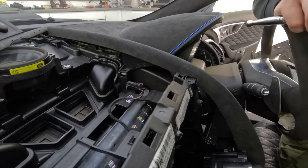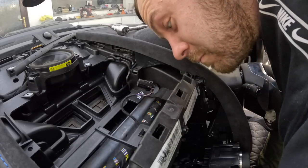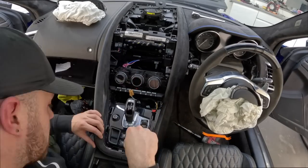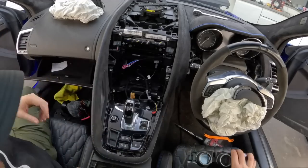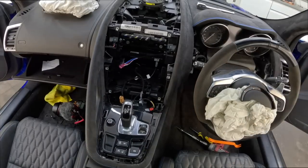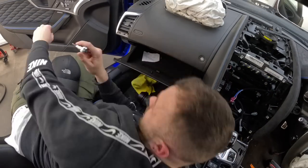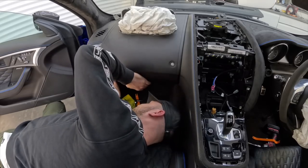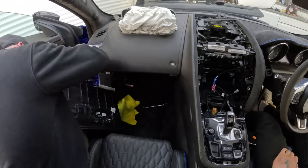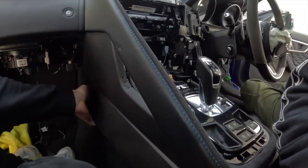The next thing I wanted to remove was these kind of side handles that go around the centre console. They were quite tricky to get off — not as easy as you'd think. To get these off, I had to remove the gear stick trim first. This reveals a couple of bolts, but there are some more underneath the second layer. To release that, you have to take the trims off the side of the centre console. The only way to get that off on the passenger side is by taking the glove box out. Luckily, this was not too challenging — four bolts holding the glove box in, two inside and two underneath, plus a couple of electrical connectors, and the glove box was free from the car.